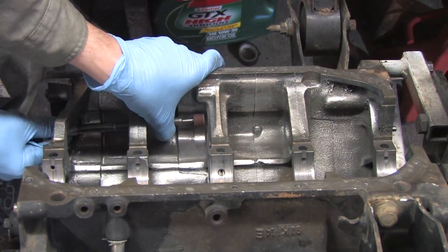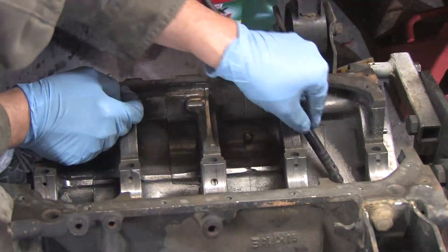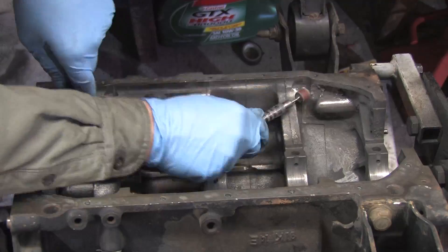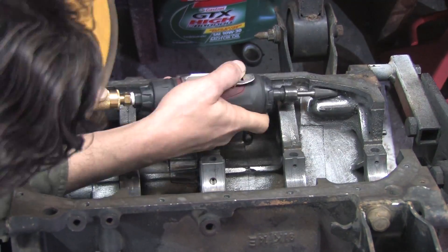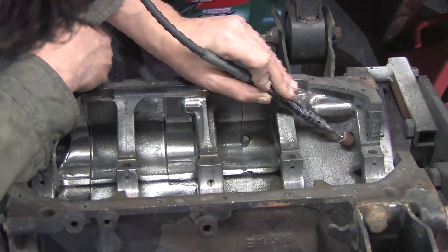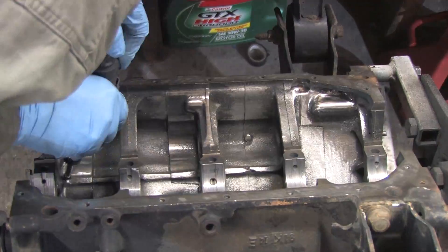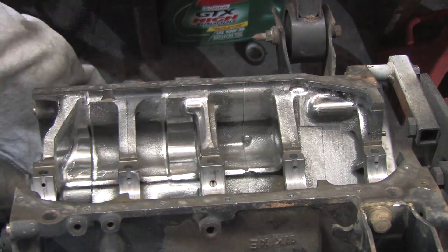Earlier I mentioned something about porosity of the surface. Oil likes to creep into the surface of the metal, and the more porous that metal is, the longer it takes for gravity to affect that oil. It flows as a film layer — picture your crank slinging layer upon layer of oil in the crankcase. The bottom layers flow more slowly where they contact the block, and the outer layers pull on the lower layer as it drains. Oil likes to stick to itself, so if you don't give the bottom layer a porous surface to grab onto, the bottom layer drains faster and it affects everything on top of it. Smoothing out the crankcase where most of the oil drainage occurs is the best means of improving your oil return flow, but you can take it a step further.